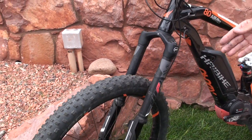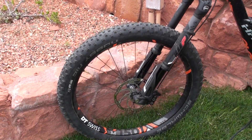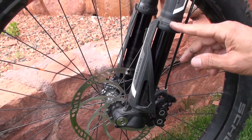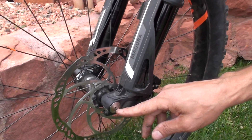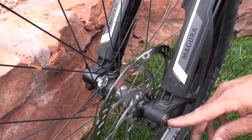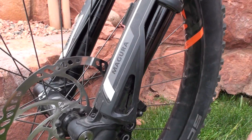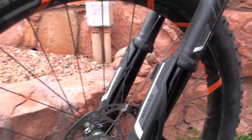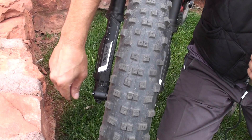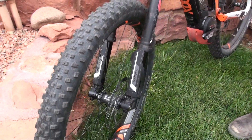In this particular case it's set up in 150mm travel, but it's also capable of 120mm travel. It uses a 20mm axle, which is really old downhill standards that have come back now to be utilized. It comes stocked with fork leg protectors, and another unique thing is it comes with its own magnetic tool to access the axle. It's pretty clever.